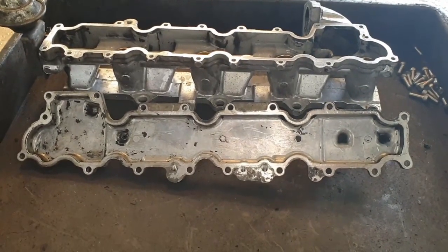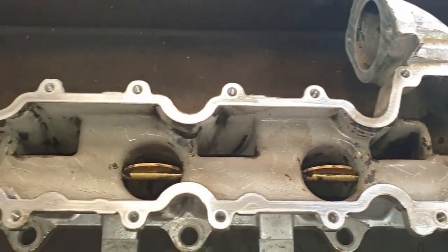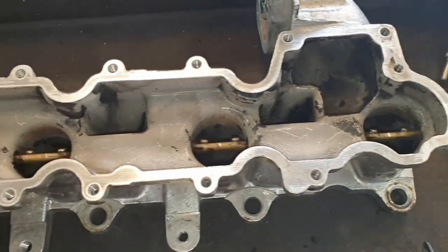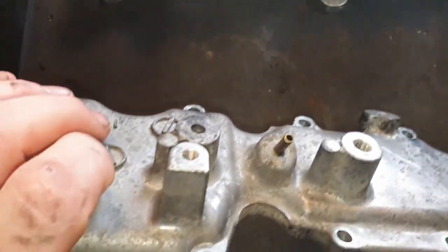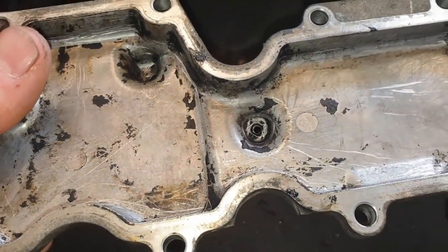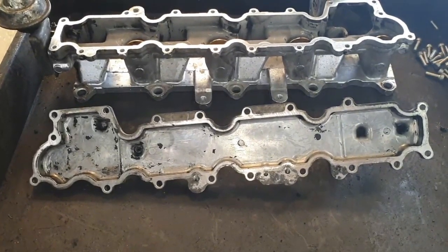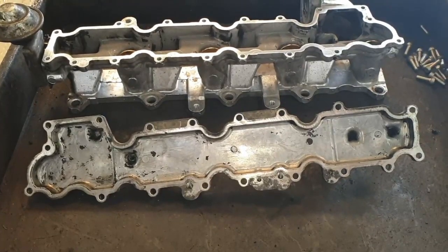And these are the results now — we're all cleaned out. That's going to breathe a substantial amount better. You can actually see now the swirl flaps built into the manifold there, as well as obviously where the boost pressure unit comes out — you can see that goes straight through into the manifold. We've got a full set of genuine Mitsubishi gaskets; we'll get this rebuilt, get the codes cleared, and get it up the road to make sure it's all good for the customer.